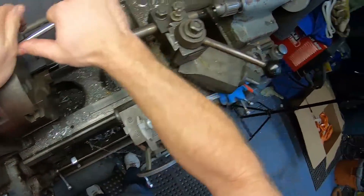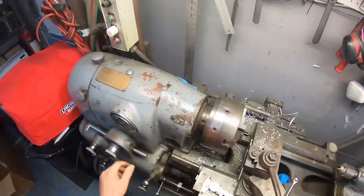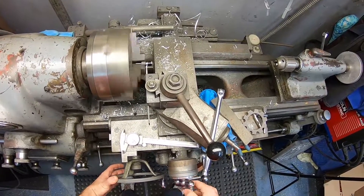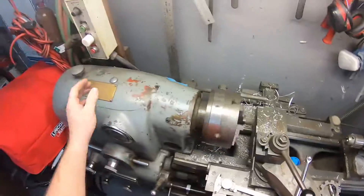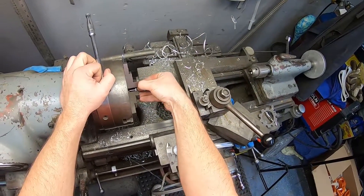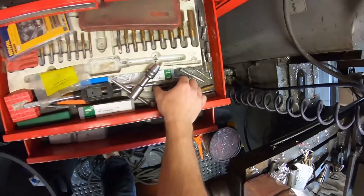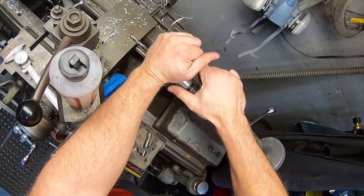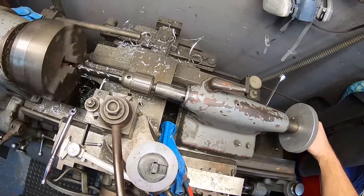This helped keep us on schedule rather than ordering another part and waiting. Here I'm setting up the lathe with a parting off tool, chucking up the check valve and cutting off its backside right behind the hex. Once that piece was parted off, the spring and check valve ball fell out of the body. Then I look at my drill chart, figure out the correct drill bit size, grab the 1/8th NPT tap, put the drill bit into the lathe, kick it back on, and drill down inside the part just enough to run the tap in and get the threads needed to use it as a nozzle holder.